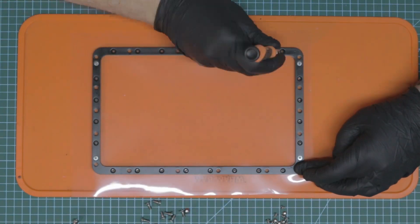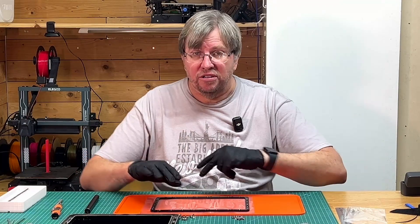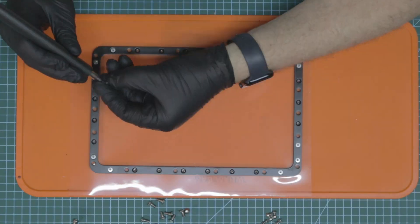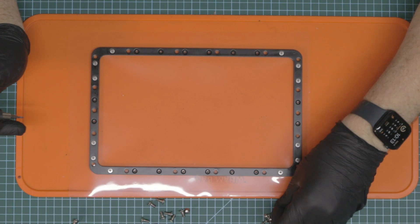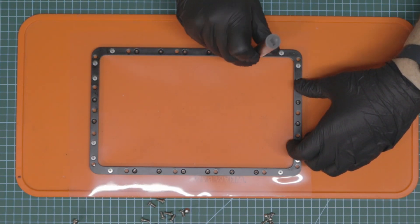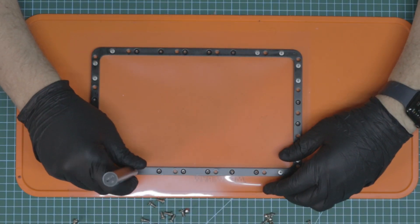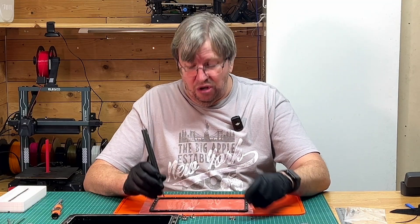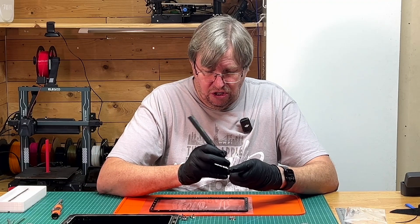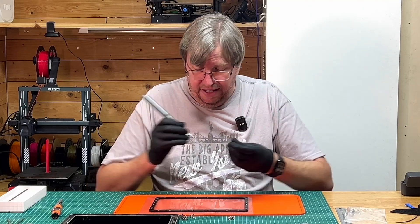Let's go and do that quickly — all the way around. Now I'm going to put all the screws in; we'll run through this with a quick time lapse. You'll notice that I will crisscross as I go across. Take your time with this, make sure that you don't damage the middle part. Work all the way around screwing everything in nice and tight — don't rush this. The crisscrossing method isn't 100% needed here but it comes from the automotive industry, where you tighten up an engine block using crisscross tightening. I prefer doing it that way — it does help.